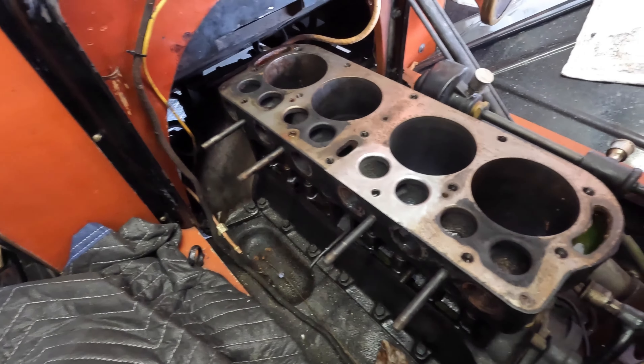While number one is cooking, we can get number two disassembled. On the oil ring on these pistons, they have a little spring-type deal underneath the rings themselves. There it is. The new ones don't have that - just a different design, I guess. Here's piston number one out of the ultrasonic cleaner. Sure does a good job - it's a perfect tool for something like this to get down into the grooves and on the interior of the thing.